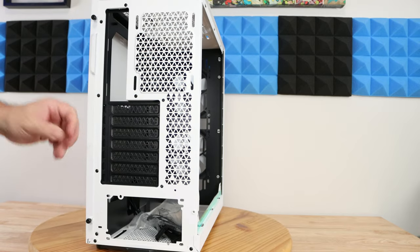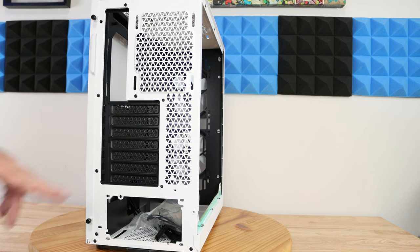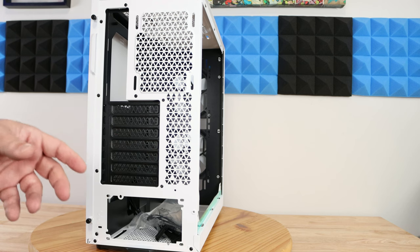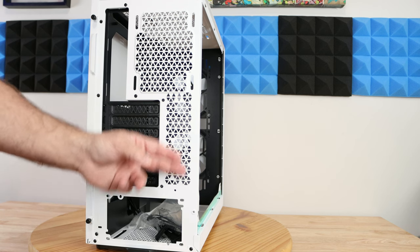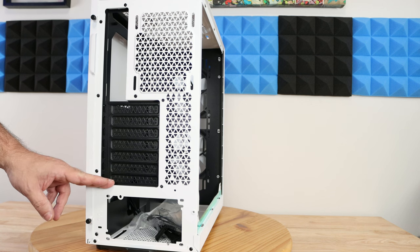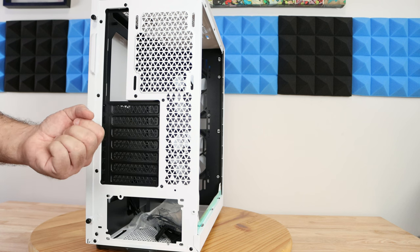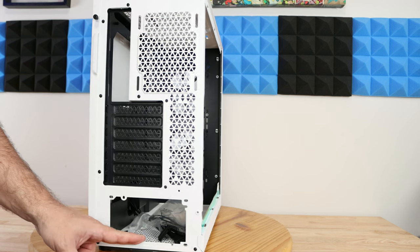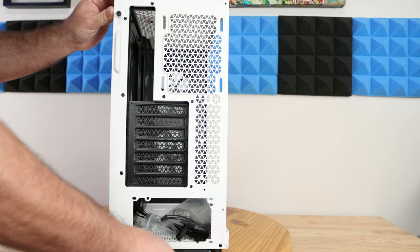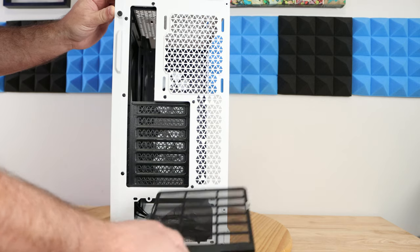Okay, so right over here, we can fit up to a 120 millimeter fan. This does not have a vertical mount, but they do sell an adapter, which I'll list down below, that lets you fit a vertical mount here. This has 7 IO expansions and they are breathable as well, allowing air to be pulled in or pushed out. And then we'll find here where we can put the power supply, and along the bottom there is a filter for the power supply, just big enough for the power supply.